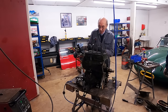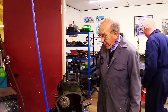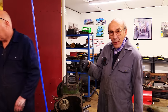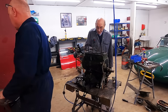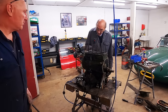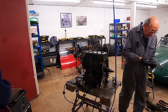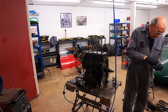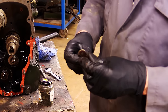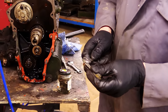Right, so now we've welded that on there, and obviously it's been red hot, so that's helped to loosen it anyway. And when they bang those in, they've got a sort of thread on them, as they go in right-handed. So all you do, look, is undo it left-handed, and it comes off. And it's not damaged at all. As it happens, that rivet there has broken off, which is a bit of a shame, but it doesn't matter, we can get that out.